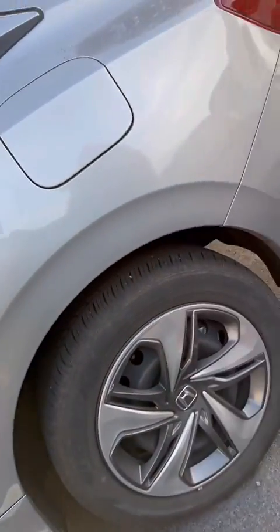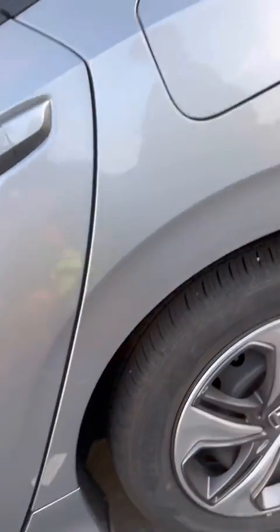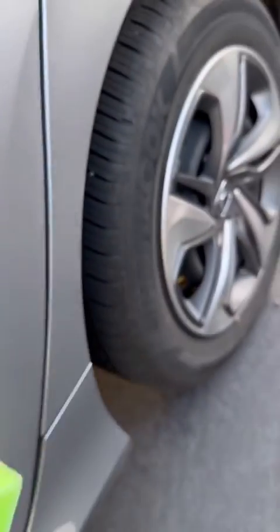This is me leveling. I am very, very gently leveling, just kind of gliding across the top, because a lot of beginners will push very hard like it's a ceramic and the damage will come back. As you can see, it looks 100% better — none of the scratches are visible and you have a nice gloss.